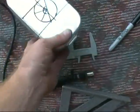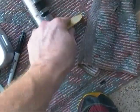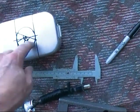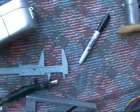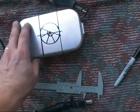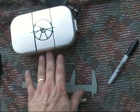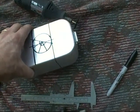So I've got this little small aluminum box — it's like a little camping box, about a little over three inches tall. I'm going to cut a hole out here to go around the fuel pump so this filter sock will sit down inside of here, inside the fuel tank. I'm going to cut a hole, strap it on, and clamp it on with a hose clamp. Then I'm going to drill some holes in the side of the box at the bottom so that when the car is sitting flat, gas will flow into this box — the level of the gas will be the same in the box as it is in the tank.